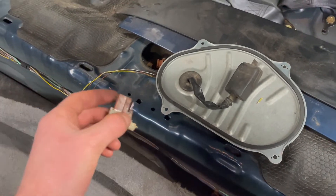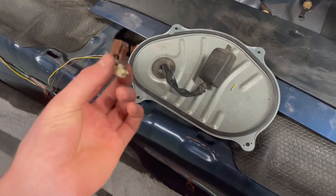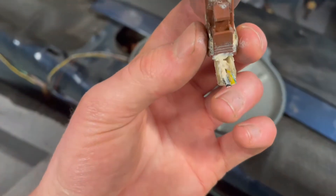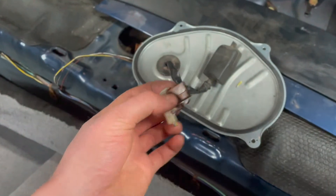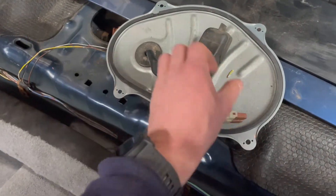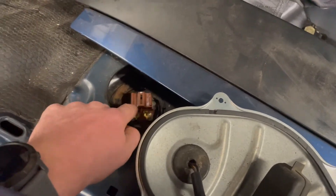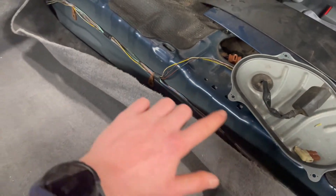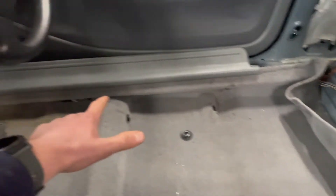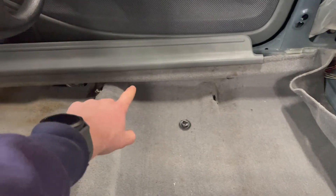But this is the fuel injection wiring loom, and I plugged it all in here. There were two wires — a green and a yellow with silver dots, and a black with silver dots that come through here. This is on my tank so that'll just plug in, but I've basically pulled the two wires all the way round and through. The black's just a ground.